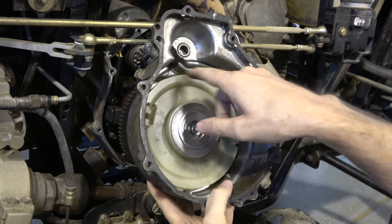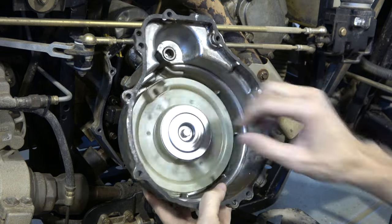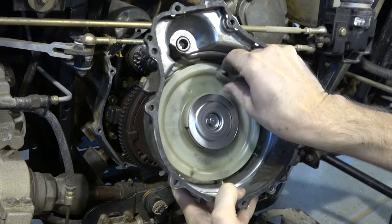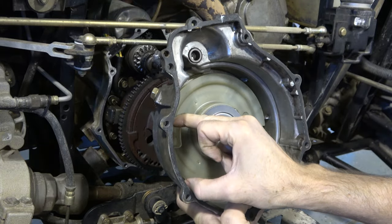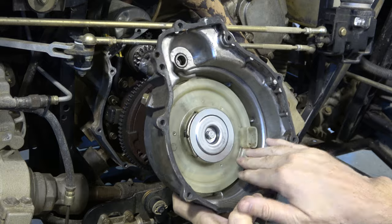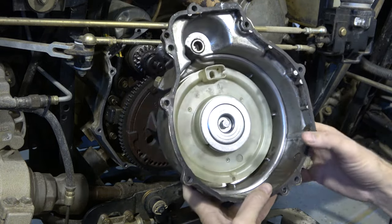When I opened that up I saw the rope in there, still broken off. I'm fortunate I don't need to do anything with this inner mechanism. When you spin this counterclockwise, that's how you preload it, and then you tie the rope on with all the rope hanging out, let go, and it winds it back up. They say six to seven turns.